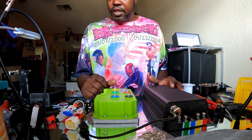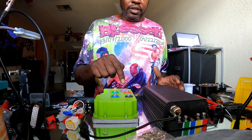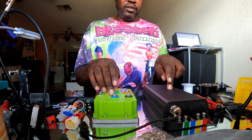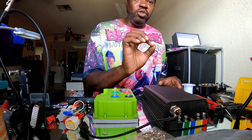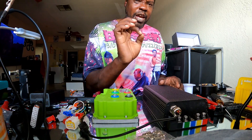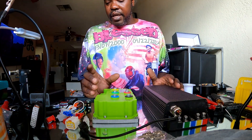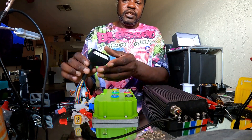I think I've covered everything. You're going to get your money's worth from the Fardriver — it's a lot more powerful even though the Sabvoton is 200 amp and 450 phase on paper. The Fardriver delivers smoother performance. Both are sine wave, though I'm not sure if the Sabvoton is FOC — let me know in the comments. With the Sabvoton hooked up to a QS motor, you'll hear a high-pitched noise when you give it throttle. The Fardriver is completely silent. Both controllers are also waterproof — I forget the IP rating, but both are water-resistant enough to ride in the rain. The Fardriver's harness connector has an orange rubber O-ring.